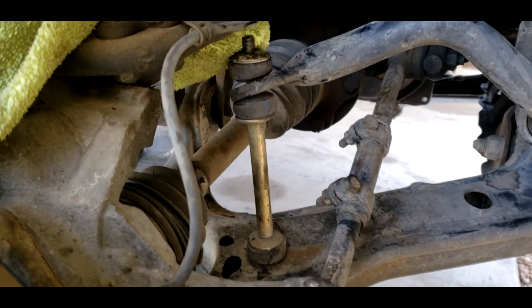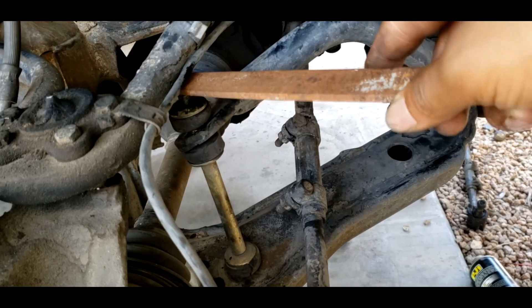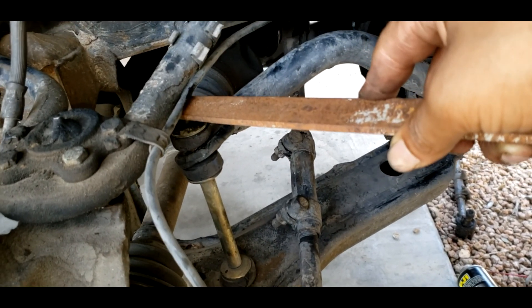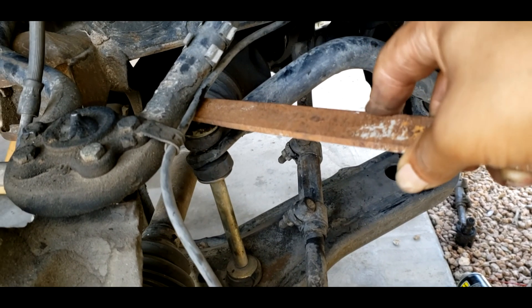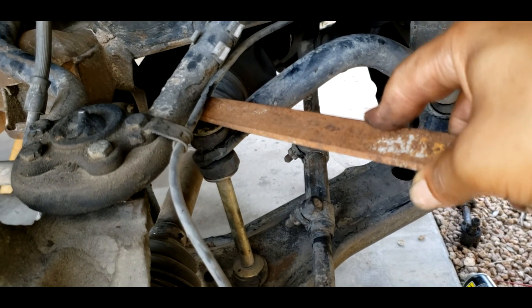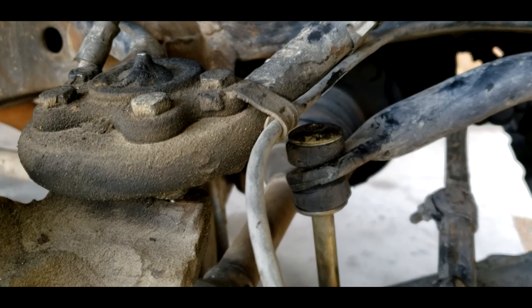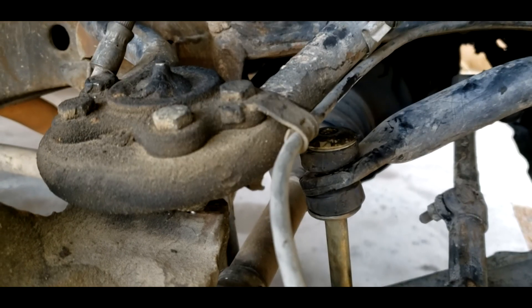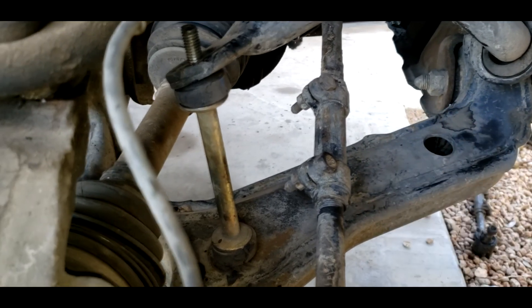This needs to go down but it's not moving down too freely. What I'm going to do is take this old file, shove that right there and hammer that down a little bit more just so it gives it that couple millimeters to move it down. I just need something to hold it flat because I can't really get in there to hammer this bolt down. Hopefully between that combination this will work. Just what I thought — a few little baby taps of the hammer on that file and it moved it down far enough to get the top piece of this sway bar end link out.